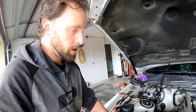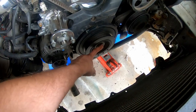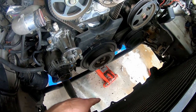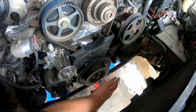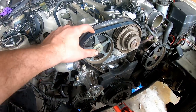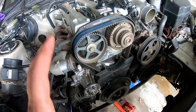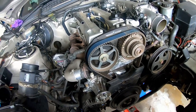Now we are ready to continue with what this video was intended to be about — doing our valve stem seals. We'll get our bottom pulley off. A lot of people have trouble with these. I did mine up to torque spec when I redid my timing belt not long ago, so this came off with a rattle gun as it should. You shouldn't have to use a breaker bar and try to start the car — that's disgusting. Now I've just got to grab my puller set, pull this bottom pulley off, get the timing belt off, mark everything up, get our cam cover off and have a look at these valve stem seals.